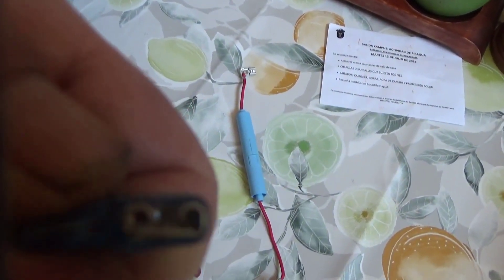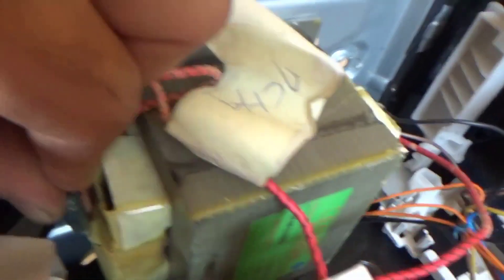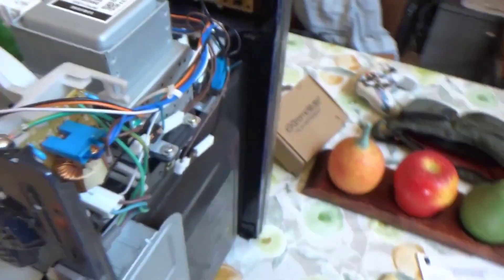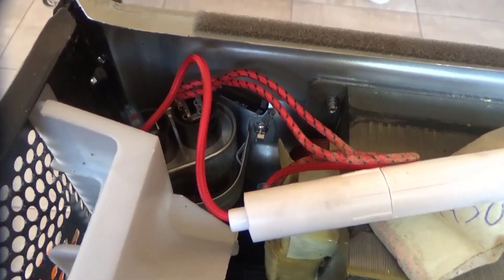Let's see if it's true. This fastener that comes here is a little less tight than the original fastener, so it goes in and out too easily — I want it to stay a little more fixed. With some pliers, I'm going to tighten it a little so that it has more force. The fuse is already in place, connected there to the transformer and the capacitor. I'll put the casing on, test it, and if it works, it's fixed. If it doesn't work, the next thing we'll have to check is the capacitor.